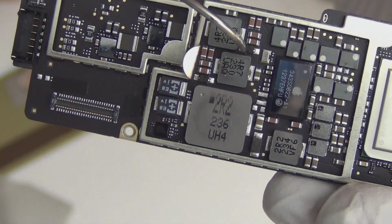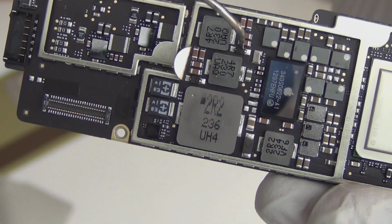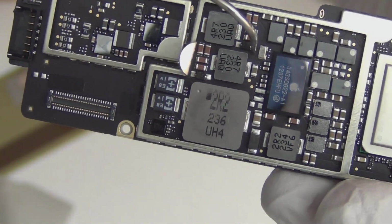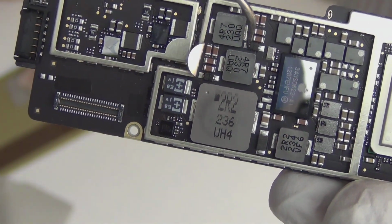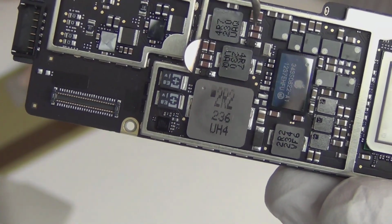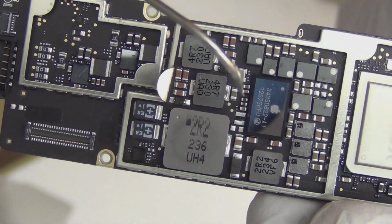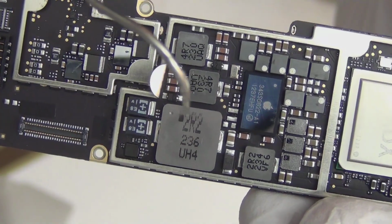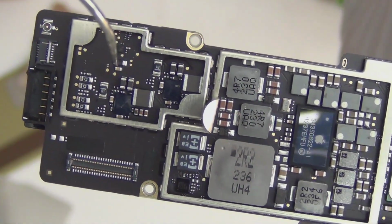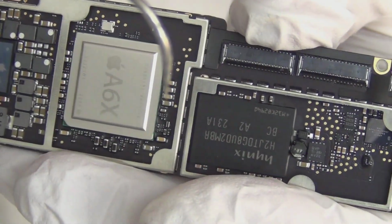We sell this as well on our website, cyberdoctorllc.com, Cyberdoc LLC. Okay, so this is the backlight IC, backlight coil, backlight IC. There's 2 of them, 1 on each side. So you have 2 backlight tracks. There should be a filter for current for the backlight as well somewhere. Maybe it's in the back. I will look for it on the microscope, and that's pretty much it.